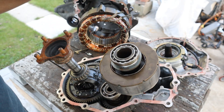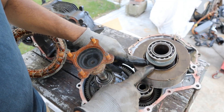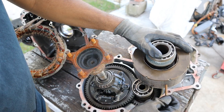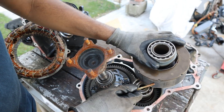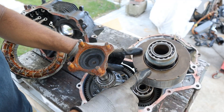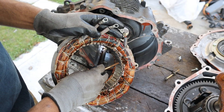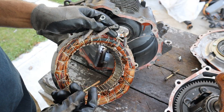Fitting over top the rotor is the stator, which sits inside the other side of the transmission casing. The rotor has many different magnets inside, and they're facing north to south. If I drag a pencil across, it's kind of jumpy as it moves from north to south poles — it's only attracted to some of them, and that's key to how this works. On the stator we have three different windings, which correlate to three separate sets — every third one correlates to one of these.